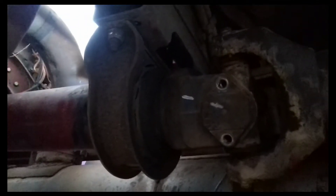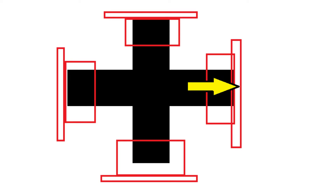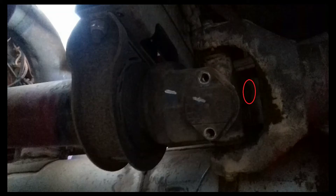The first step to replace the center bearing is removing the universal joint so that we can access the yoke. The basic principle of removing a unijoint is using the cross shaft to hit out the cap. Because you don't have direct access to hit the cross shaft, you hit it via hitting the yoke, bringing it back to the truck. If you wanted to remove the back cap you would hit the yoke here, and if you wanted to remove the top cap you would hit the yoke here.